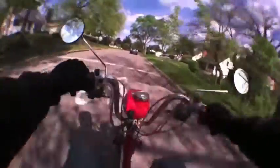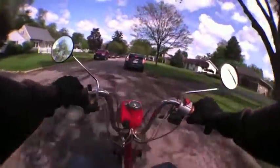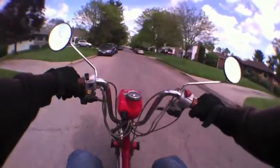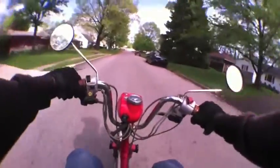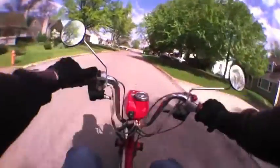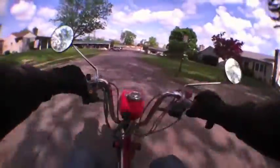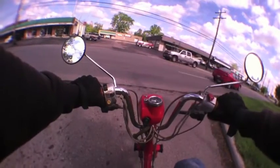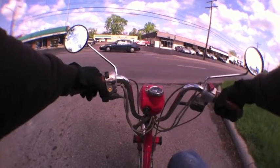It must have been originally close to 0.25 because I had a hard time drilling that, and trying 0.30 helped a little bit. I then did 0.35 and everything seems to be pretty good so far. I'm not sure what size the main jet is on this carb, but right now I'd say it's dialed in pretty close. It might even run better than it ever did with the old stock carb — it seems like it has a little better pickup and I might have gained a mile or two per hour on top speed.